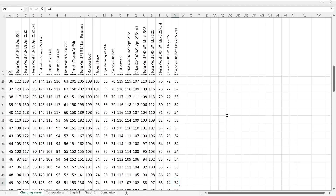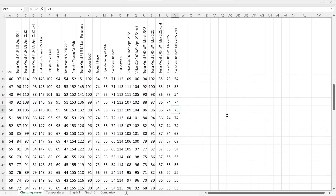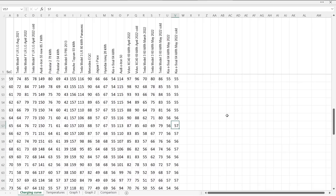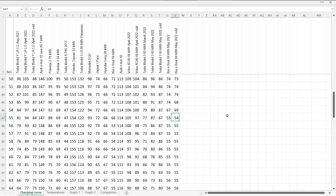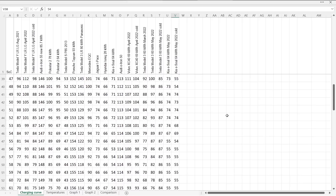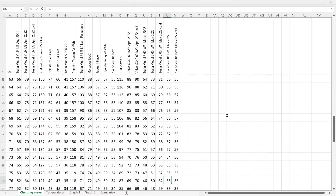You don't get any extra boost. It would actually be better if the battery heater ran until 25 degrees Celsius before it stopped, because look how long it took — we had to reach almost 50% before we hit 74 kilowatt. And then we only had that for a little bit, and then we had to throttle because at 55% we reached the next throttle point. But it seems like at that point, pretty much neck and neck — once we recover and come to this point, roughly at 49%, that's where the two charging sessions are just neck and neck.